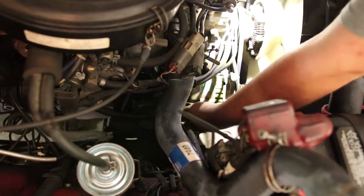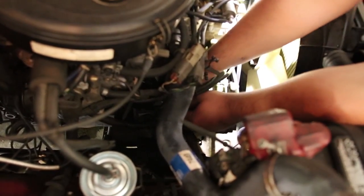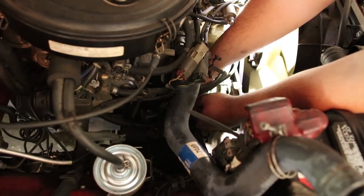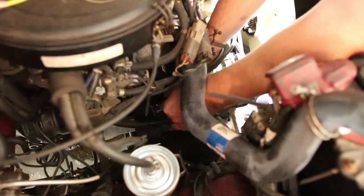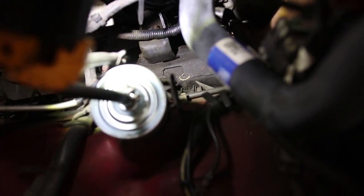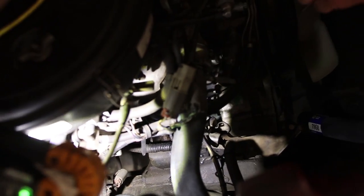That's the bolt, and this guy here is our clip - a plastic clip that's 30 years old and a little salty about being on there the whole time. Push in on this bit, push it and pull it and off she comes. And if you can see down in there - there's a bolt here that's super hard to see. I can only feel it, I can't even see it.